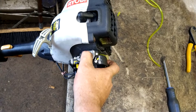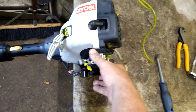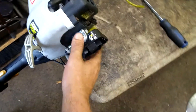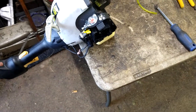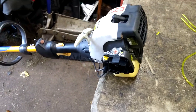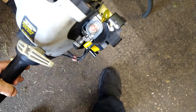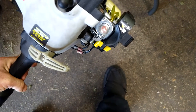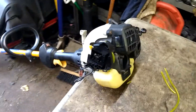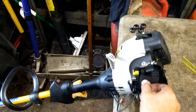The choke arm goes into this slot here — line it all up. I'm going to have to kind of force it down because it is stiff on these studs. 10-millimeter nuts — tighten them down. Put a little gas in it and prime it up. That's a good sign — it's priming, fuel is going in. Let's see if we can get this thing to run. It ran! It's running a little rich — I'll do a video on adjusting the carburetor in the next video.